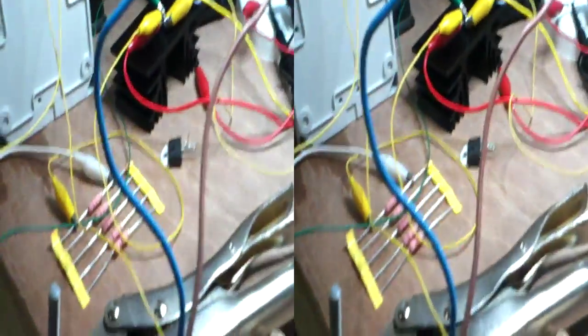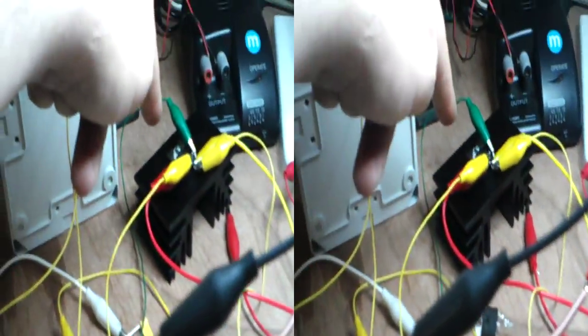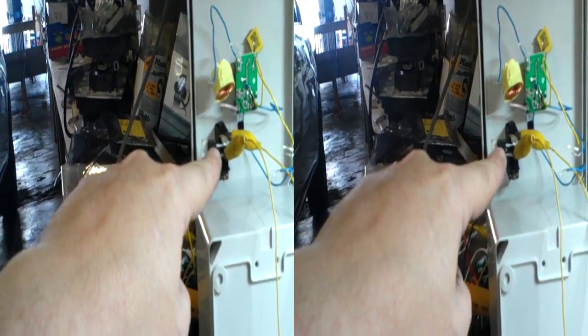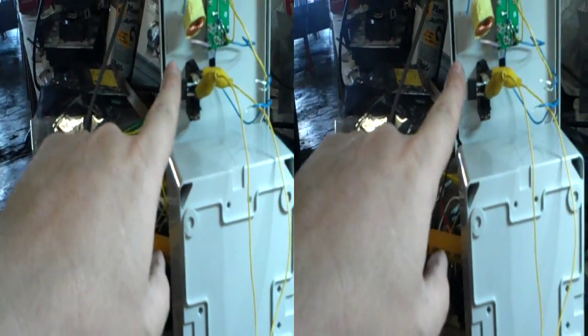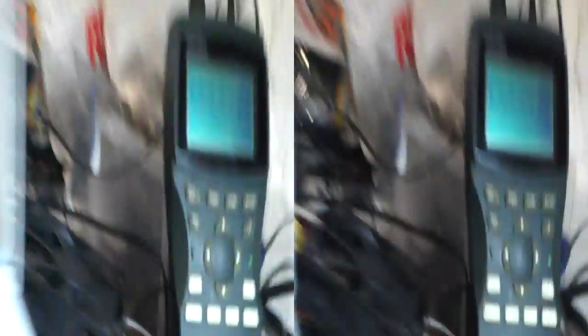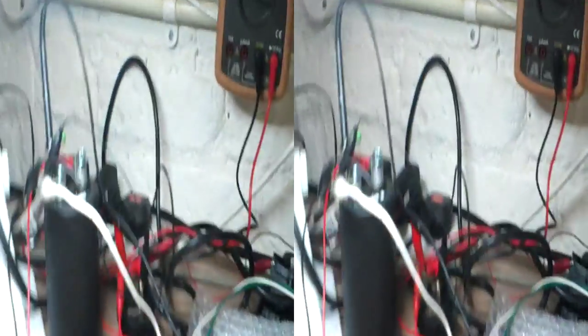This is a charger which is one three-pound component from Maplin. There's a diode and a switch there, which won't be necessary if it's being topped up — a potentiometer, some resistors. We're talking about 10 pounds worth of kit. And it's working. This is 10 pounds worth of kit to charge a Prius battery — a 285 volt battery.